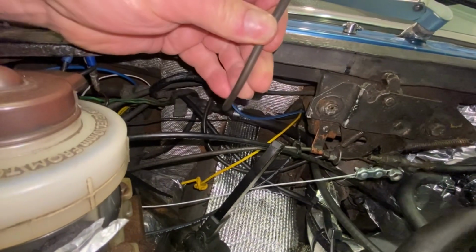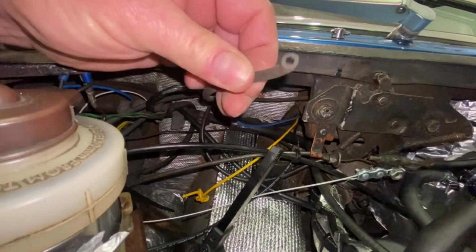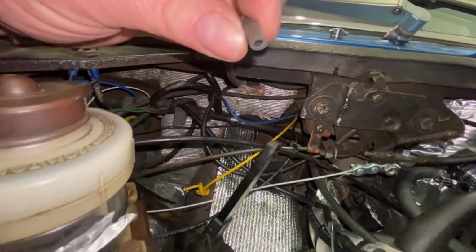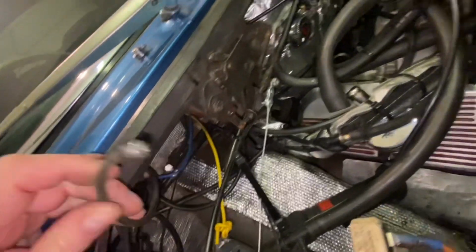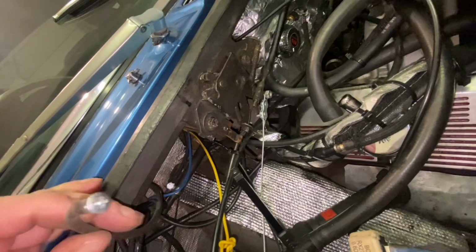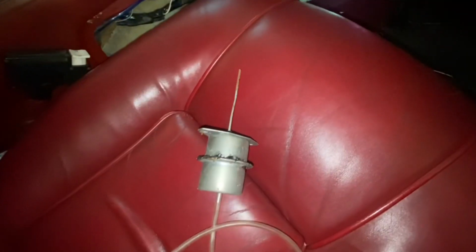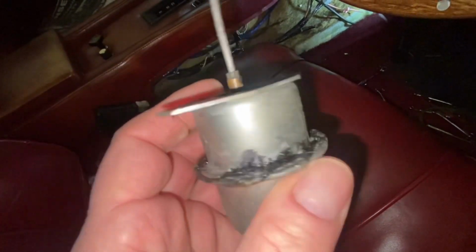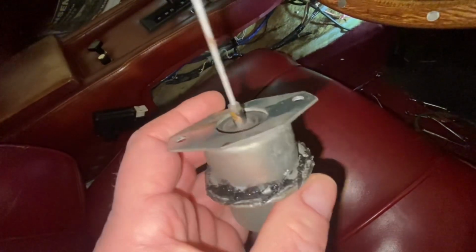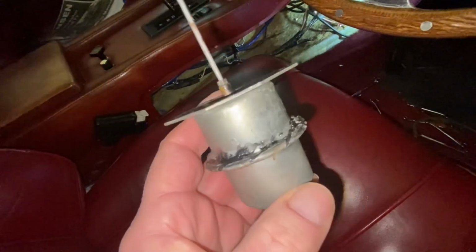This tube was connected to that leaking vacuum actuator, so what I'm going to do is put a screw in there. That screw should now stop it drawing unwanted air into the rest of the system. I've let it dry for a couple of days. I guess though, even if it had a slight leak, providing the engine's on and providing vacuum, it would cope with a slight leak.